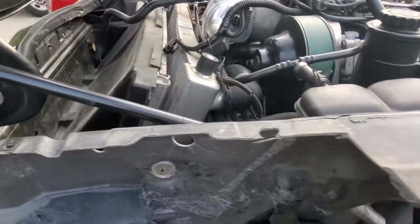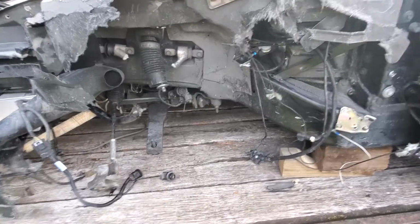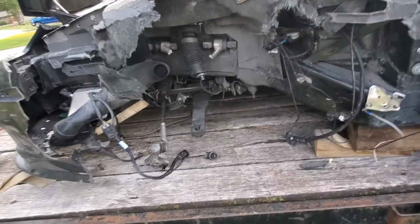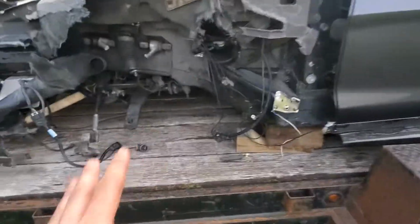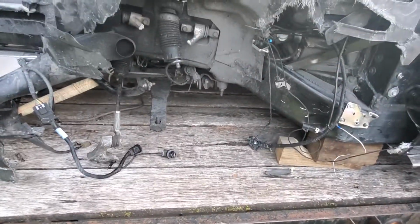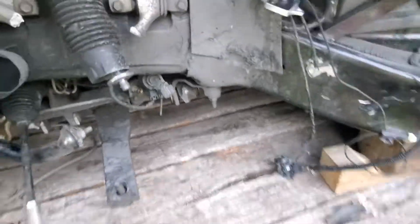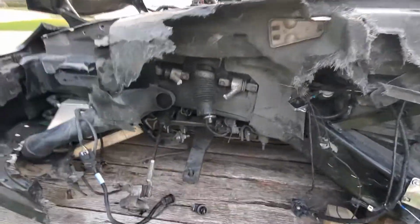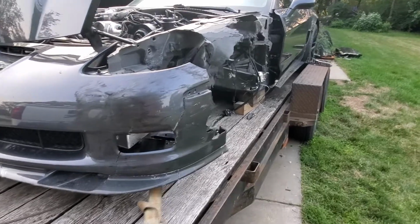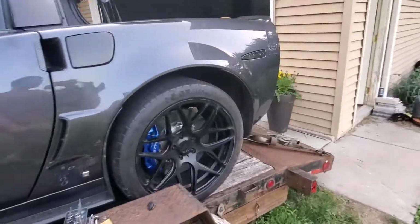It's just absolutely wild. And then the ZR1 cooling, and we've got a whole suspension corner on the way. Got a new rotor. The caliper is still good. Need a new wheel, new tire. And honestly it's not that bad. There's actually no frame damage. The tire came up and just touched here and here, but there's no actual structural damage. The subframe ripped the bolts out, unfortunately, but I have a new subframe, so that'll hopefully be going in this week. The goal is to have it on the ground and rolling. I have another wheel I can just throw on there for now. It'd be nice to put it around the neighborhood once or twice this week, while we're on the hunt for other parts.